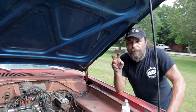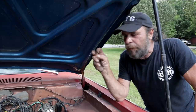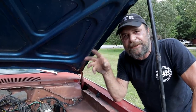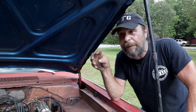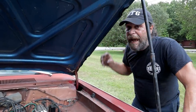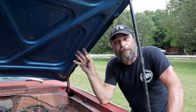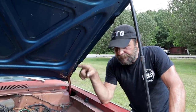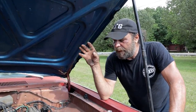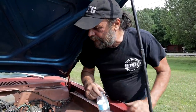What that would do is the water would steam clean the motor from the inside out. It would knock the carbon off the heads of the pistons, off the combustion chambers, off the valves. And you would keep revving it, and if you went around back, a lot of times you would see big chunks, I mean flakes, of carbon come flying out the back of it. And you repeat this a few times. It was part of keeping an engine healthy.